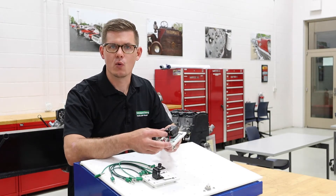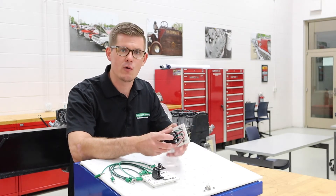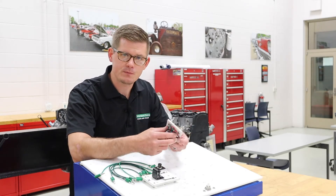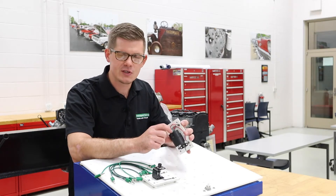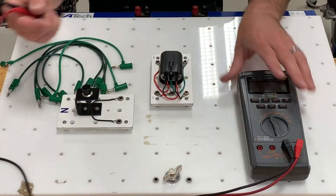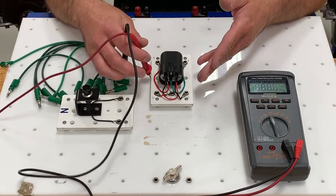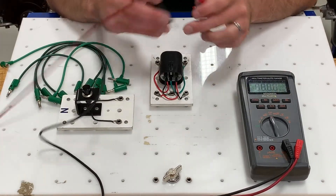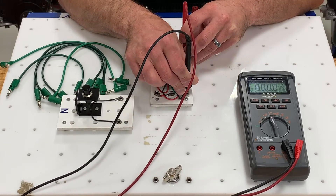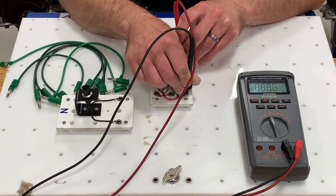Say I don't have the service information and I don't have the diagram on the outside of the relay — what could I do to figure out what all these different pins mean within my circuit? One way is a visual inspection: I could look at the different terminals, as typically a lot of relays will have different size pins. I would first want to figure out where my coil is in terms of pin assignments. I could figure that out by taking my DVOM and checking for resistance. Most relays on the coil side have anywhere from 60 to 120 ohms worth of resistance. So I could take my leads and begin testing — I know that I should find the normally closed switch, which I appear to have found here.